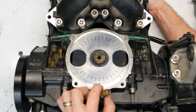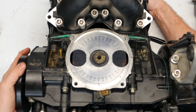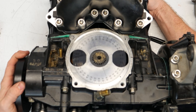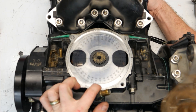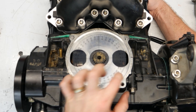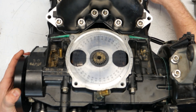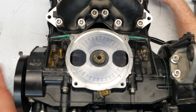I made a mark at 90 degrees on this wheel — it doesn't matter where. Then I'm going to turn it all the way around the opposite way, which happens to be right here. Now we're at 180 degrees on the wheel. Halfway between 90 and 180 is 135, so I marked it right there. Then I turn my 90 degree mark to 135, and that is exactly top dead center.